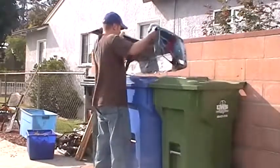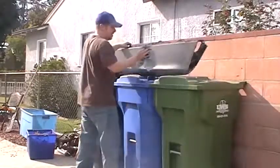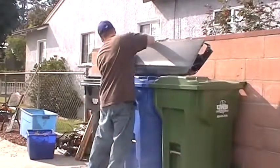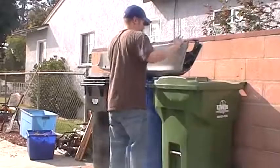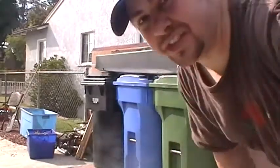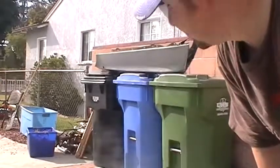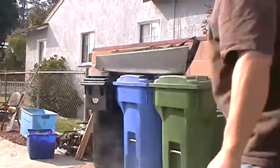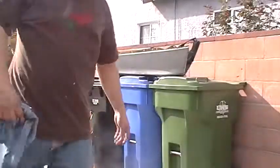I need to avoid the flash rust. I will be scrubbing the bottom side — I want to get that undercoating off of there, someone's rubberized undercoating. We'll let that piece dry in the sun for at least 15 minutes until it's nice and clean. Then I can start working on it — I'll probably use a grinder with a wire brush to remove that stuff from the bottom of the panel, and I'll probably also use that wire brush on the top side to clean that off too. Rust removal — it's all surface rust, I don't have to worry about anything structural.